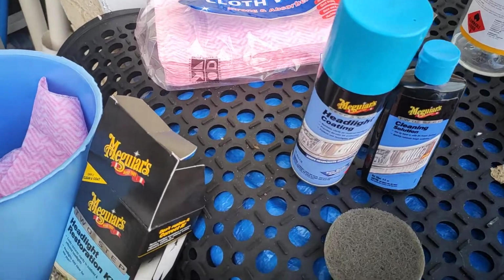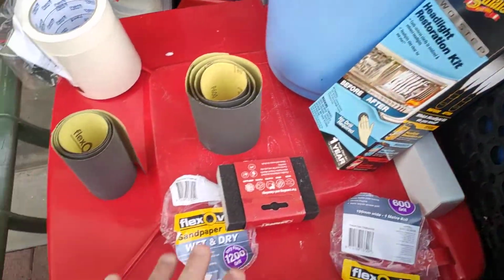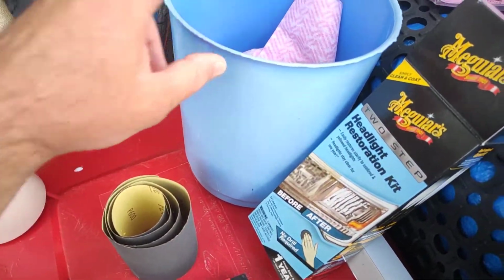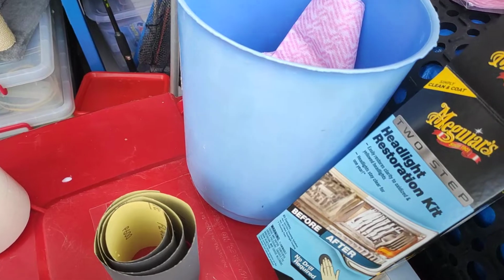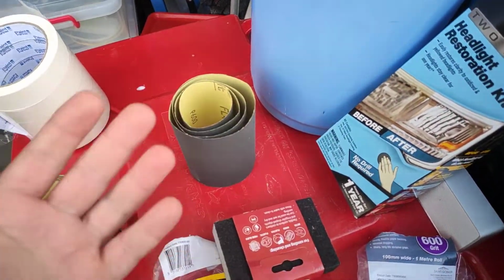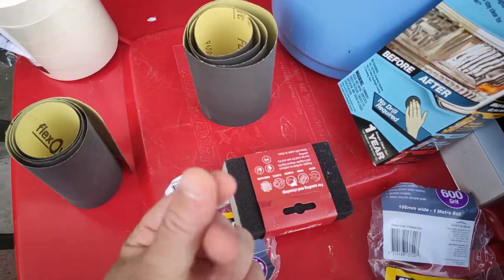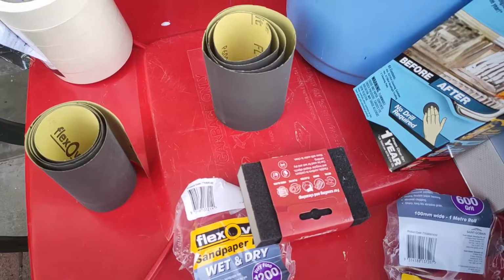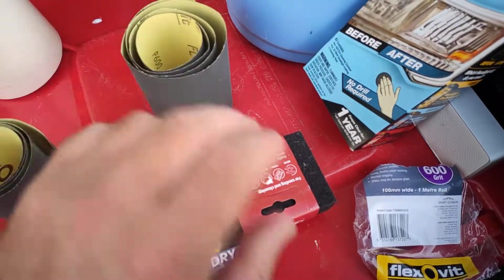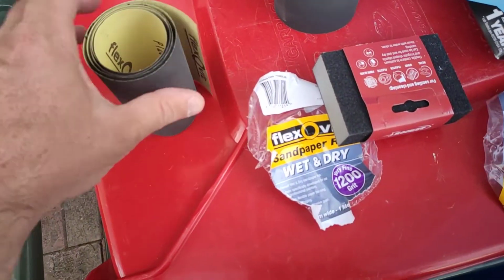and we're getting a bit carried away here. Okay, I'll get back to the sanding. So start with the 600. Just use a bucket with a bit of soapy water in there, or just water. So when you're sanding, keep it wet. It helps the particles flow, like when you're sharpening a knife. You want the little bits of grit to be able to flow away. So spend about 10 minutes with your 600, and then spend about 10 minutes with your 1200.